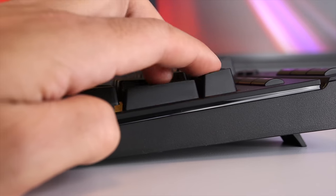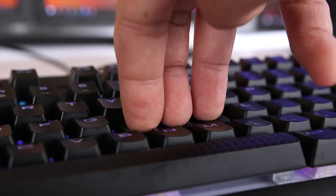Some keyboards have a limit of two keys, some have a limit of six keys, and keyboards like the K68 have full key rollover, or NKRO, so all keys can be pressed and correctly registered simultaneously — and that doesn't include modifier keys like Shift and Control. Ghosting refers to what happens when you exceed the concurrent key press limit. For example, if your keyboard is rated at 2KRO and you press three keys at the same time, the keyboard can actually register a completely different key altogether — not even one of the three you clicked. Anti-ghosting on the K68 prevents that from ever happening, so every key press you make, no matter how fast, is going to be registered correctly.